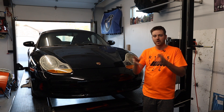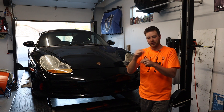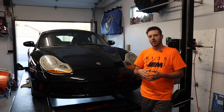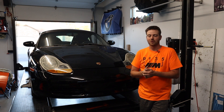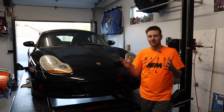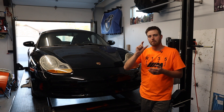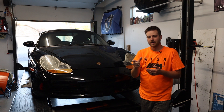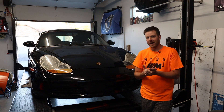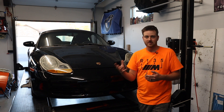The fuel pump was bad. We pulled it apart and tested it by running it to a battery — we dried it off so we weren't causing any sparks — and either way it would just lock up and stop. We ended up getting a new fuel pump, put it in, and it still wouldn't start. The crank position sensor still wouldn't fix it either. So the first thing we did was take a wire and bypass the fuel pump relay to make sure the fuel pump was actually running.